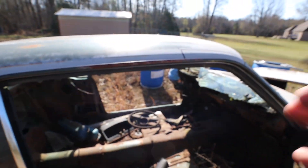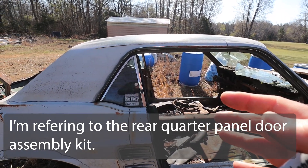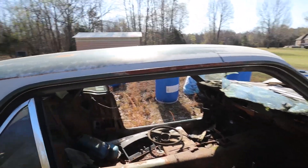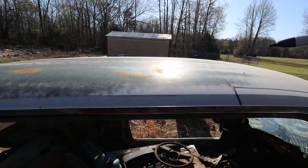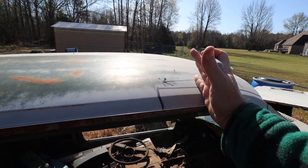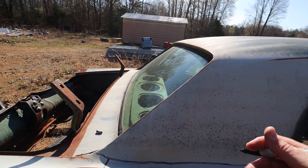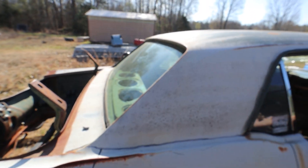When you buy your kit — if I had this car, I'm going to get my fastback kit from Dynacorn. I'm going to get my rear quarter door assemblies in the weld-in type, the type that you weld yourself. You're going to save $500 per side for that. On this one I'm only going to use the top of them. This part down here will remain. I'm going to splice that rear quarter door assembly somewhere in here, run it back, splice it into the top of my B-pillar and the structure on top of my rear wheel housings. So you're not having to use the whole thing, and I'll actually show you guys how to do that. But that's where I would cut this particular car.